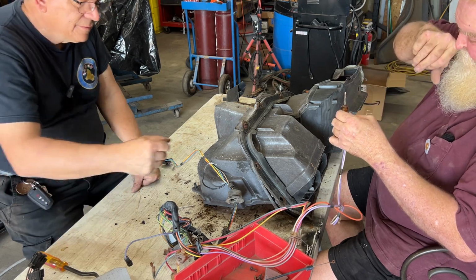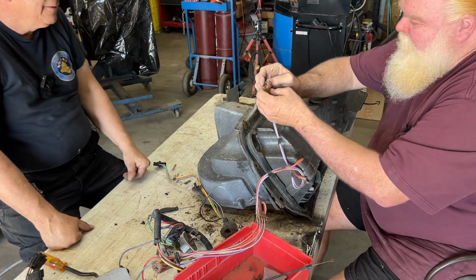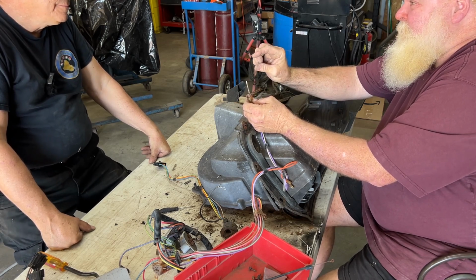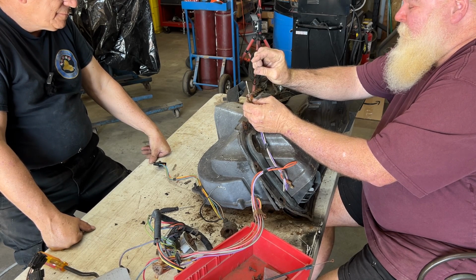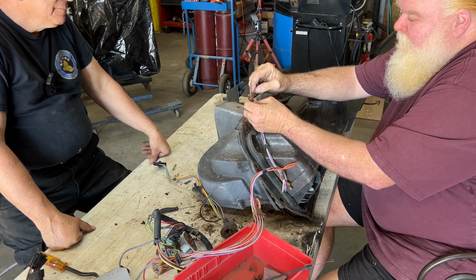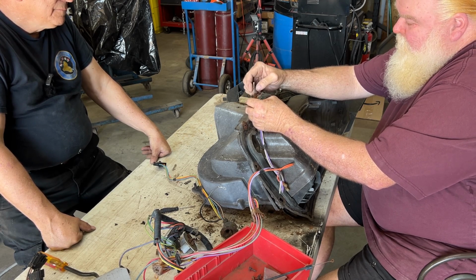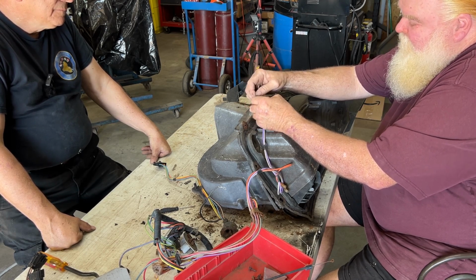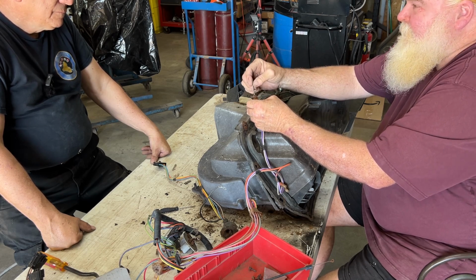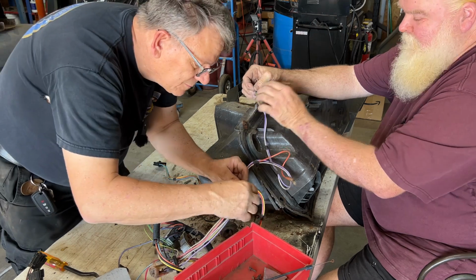So what I need to do is see if we can separate the other ones on this point, see if it's any good out there. What I want to do is go get me some of the little splice deals, and I'll cut these out and open these holes up, put some epoxy, clean this up real good, and I'll push those splice deals right down into this, and then I can do regular vacuum line outside.